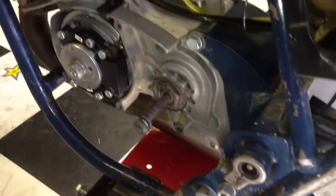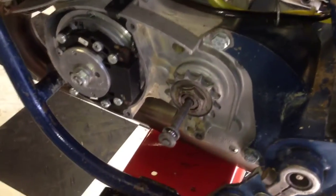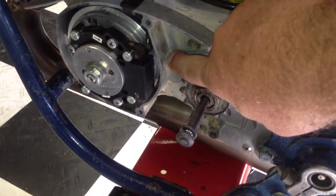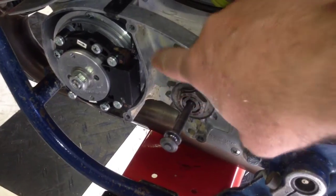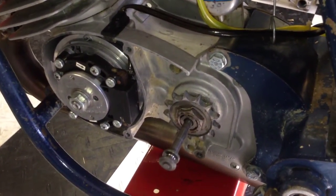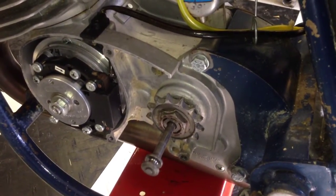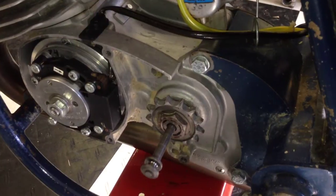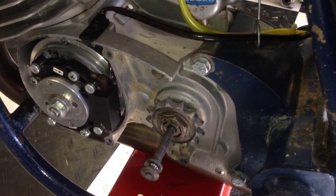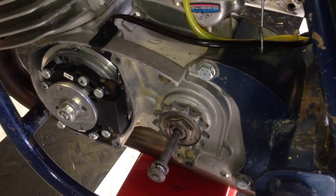Then as we come up here on the bike, I pull the shift cover off. There's usually a bunch of dirt or mud caked up in this area, so clean all that out and then leave the shift cover off — it gives it an opportunity to dry out. They're not sealed real well so water will get in that ignition area, so let the PVL, CDI points, whatever you have in there, get a chance to dry out any condensation or water.